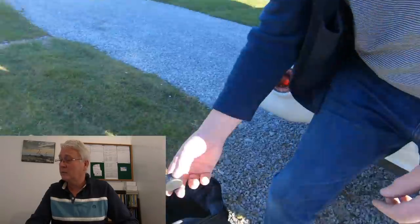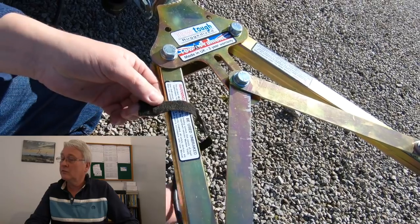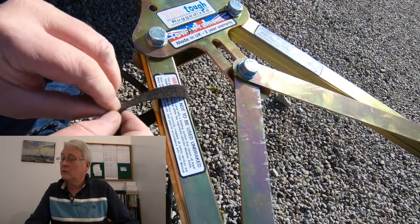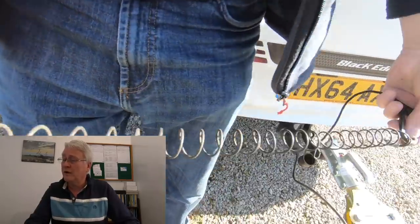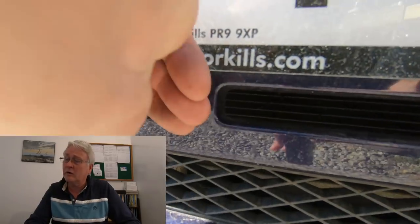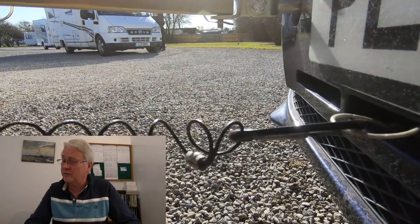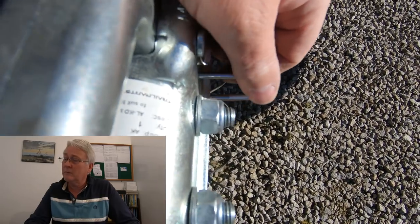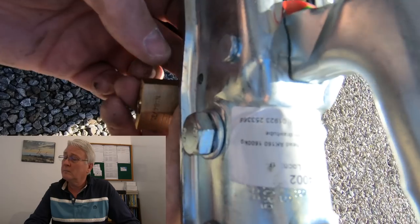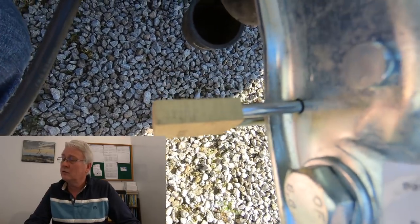I've got a little bit of Velcro strap — that's the cap that stops water getting into the electrics when it's under the bonnet. Get the Velcro strap in there and just pull it tight, but make sure you don't tighten it too much because you're obviously going to be going around corners. Now this is the breakaway cable. Unlike a caravan breakaway cable, it doesn't have to be too strong because all it's doing is pulling out a little electrical plug if the towing frame becomes disconnected. If that plug gets pulled out, it applies the brakes on the car and the car will stop even though your motorhome is ongoing. There's a little lock to secure it to deter any opportunist thieves — though any determined thief could probably manage it, but remember the car is going to be locked when we're towing it.